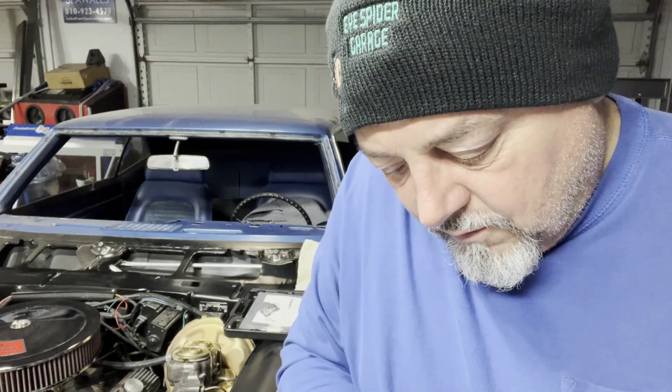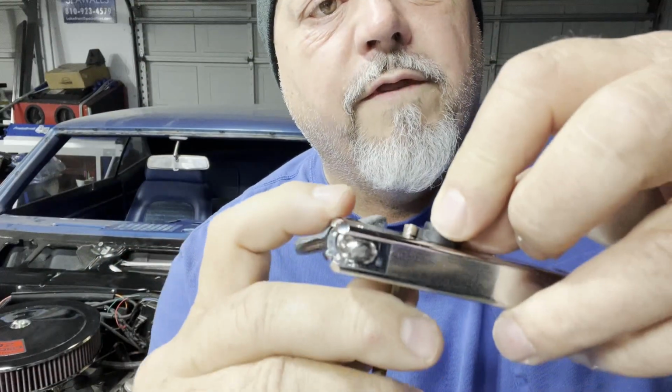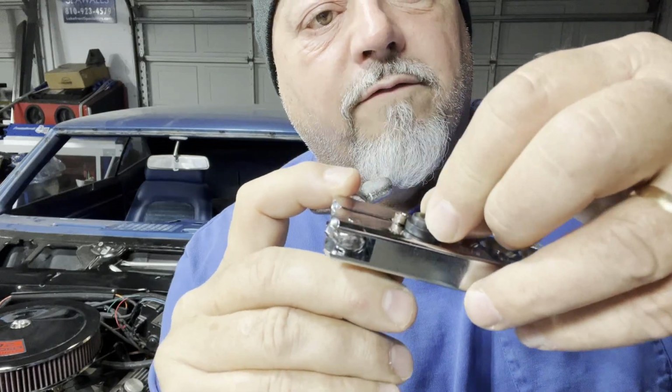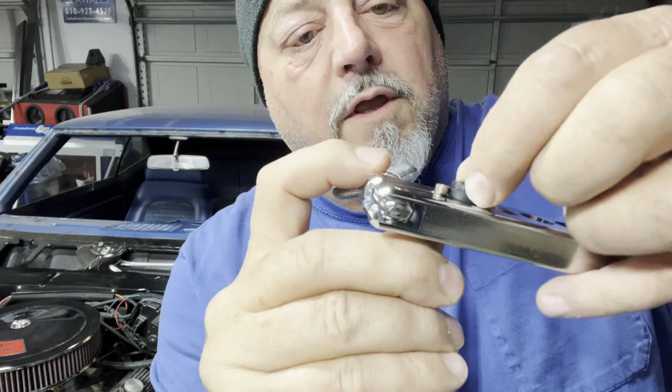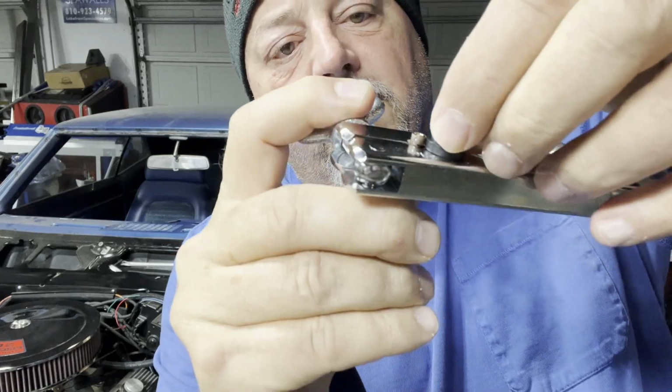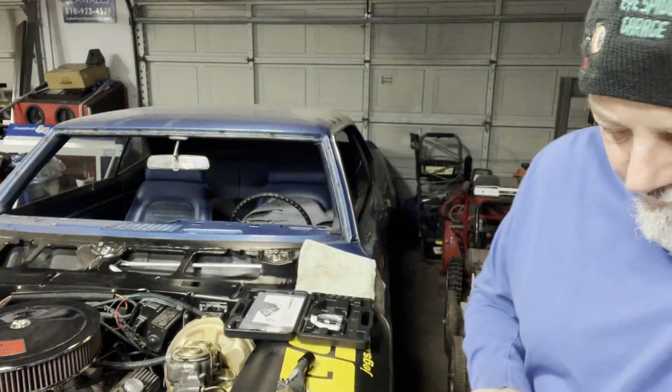Okay, there's two surfaces on this tool. You want to go to the first surface, and that's what we're going to do here. So once I tighten this up, I'll show you. Hopefully that comes through for you clearly enough. But the height of this end of the tube is to the first step on the flare tool. Okay? Yeah, it looks good. Okay.